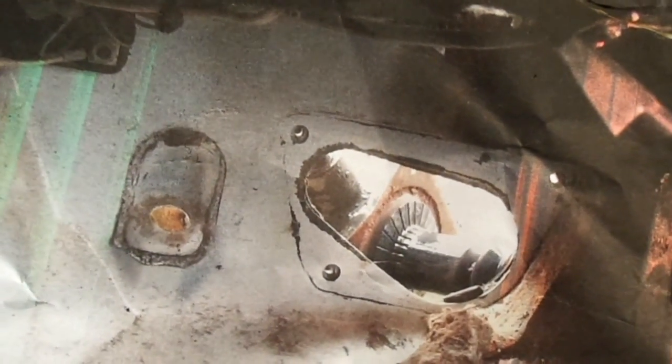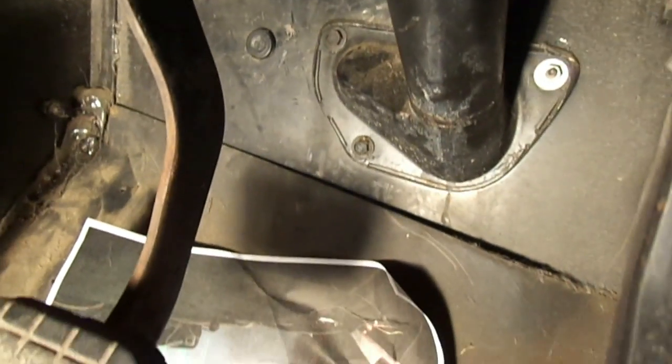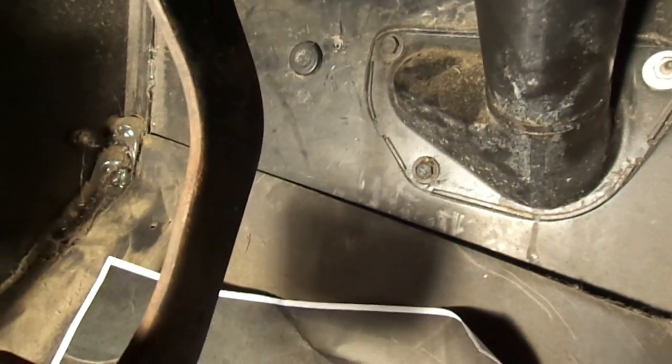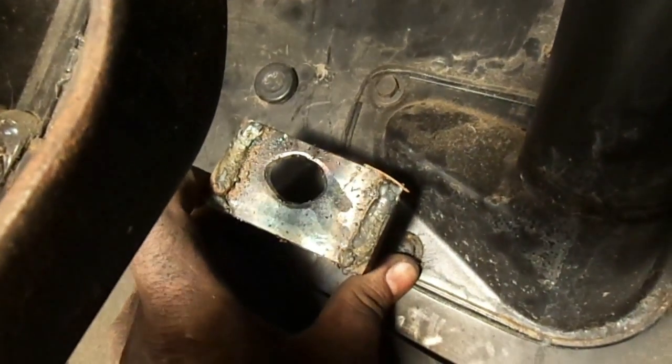This is a picture that I took of the parts truck that I got my transmission from. You'll notice there's a hole right here, and that's for the clutch pedal or the clutch cable. Well, up here on my bus you can see we don't have that. See the steering column? There's a bolt there but that's not for it, and this thing's angled too. So I'm building a clutch cable mount to go right there. This is just a piece of angle iron - I capped it off and drilled a hole for the clutch cable to come through, and we're going to line it up just like the one on the parts truck.